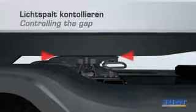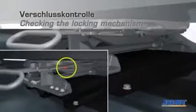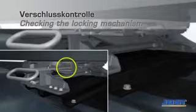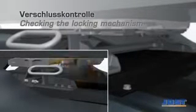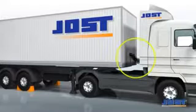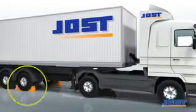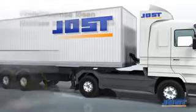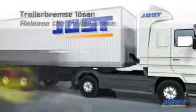No gap must be visible between the semi-trailer rubbing plate and the fifth wheel coupling. With one-hand operation, the indicator pin must no longer be visible. With the automatic latch, the latch must be in the closed position. With Flashtronic equipment, the LED must flash. The driver then connects the hoses, winds up the landing legs and removes the chocks. The vehicle combination is ready to start after releasing the trailer brake and the start-of-journey check.